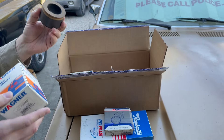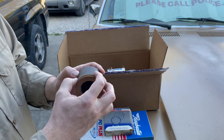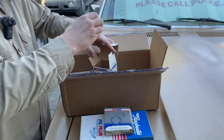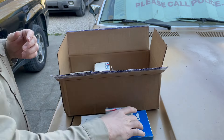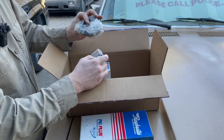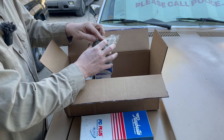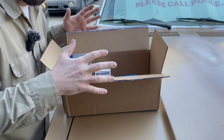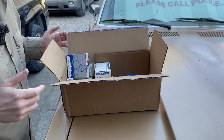This is what came on the car originally. I think the issue is maybe the piston got cracked or nicked and it's swelling, getting caught in the bore of the caliper. I did a little research on that style of piston and that can happen if the piston is really old — these look like they've been on a shelf for decades. Anyway, we've got new seals, new pistons, and a new soft brake line. Hopefully this fixes the front brakes and I can get this car back on the road.